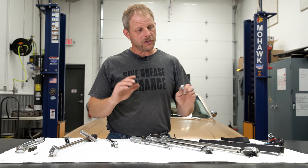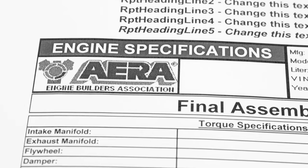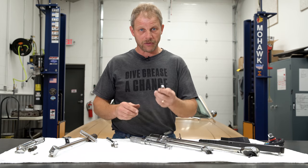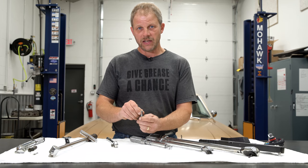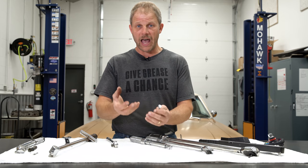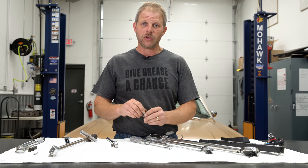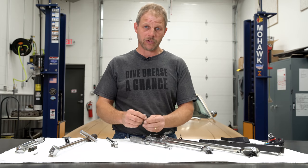You've got your torque wrench and you know how to use it. Now, if you want to understand why there are certain torques on certain bolts, that's a very in-depth conversation relative to the manufacturer's design approach — a lot of testing and calculation. That also flows into grade 5, grade 8, and those types of bolt ratings. At the end of the day you have clamp load. A bolt can only maintain so much tensile strength; if you exceed it, it actually starts to stretch. That's where torque-to-angle comes in — those bolts want to be stretched, acting almost like a spring holding two plates together. If it is a torque-to-angle application, that's considered a torque-to-yield bolt — a one-time use bolt. Use them once and throw them away no matter what they look like. When it's just a standard torque, you can use common sense and often reuse those bolts if they're not damaged.